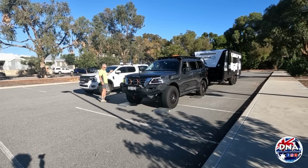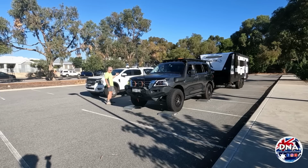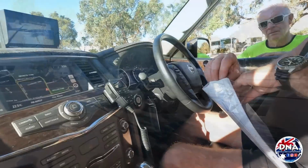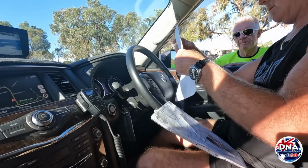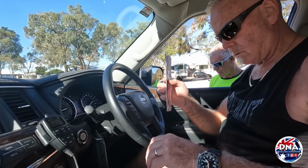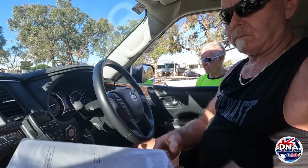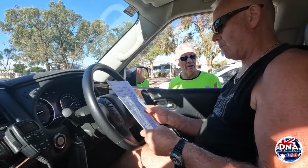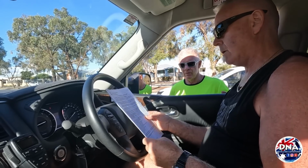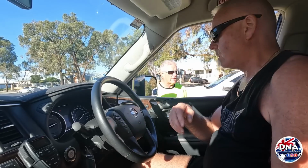Right, we're just weighing the car, just driving up. Two and a half tonne. Great. Well, you're about 2.1, so you're well within on the rear axle, which is good, because often you get a GVM upgrade and the rear axle doesn't change. Yep. And the GCM doesn't. So we've changed, the actual lower control arms are all rated at 4.2. Yeah, no worries. Sweet. Okay, what I'm going to get you to do now is just drive forward and we'll bring your wheel up to this scale and I'll move the other one back.